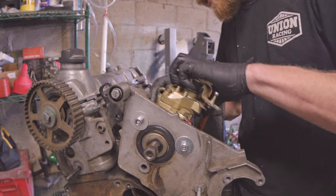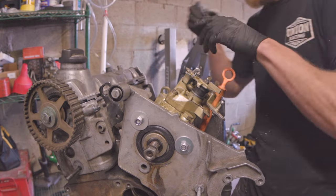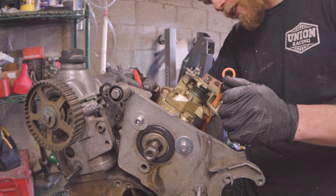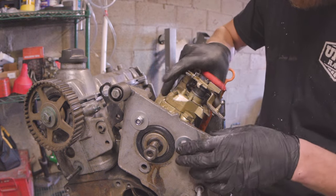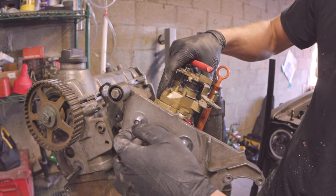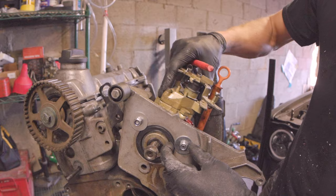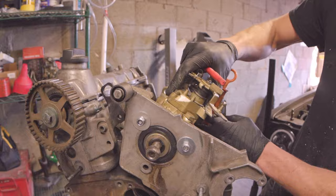The one more thing I need to do is notch right back here. The back side of this bracket has a little fold-over that needs a notch, because right now there's no way to tighten this bolt — I can't get to it. I'm going to cut a little notch out of there. My other modification is to get slightly bigger fender washers; that's the whole reason for the washers — to hold in this spacer. With bigger fender washers that'll be no problem. We are kind of hitting the dipstick tube but I don't really see that being a problem.